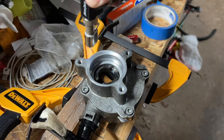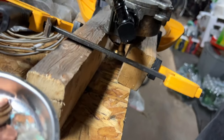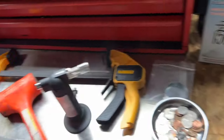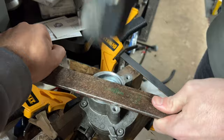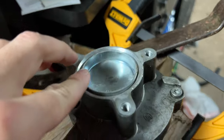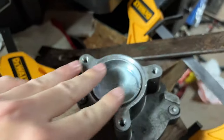We're just putting some heat in it right now so it expands to help it slide in a little bit better. Got the freeze plug. We got the little jig going right now. Two 2x4s, two clamps. All right, boys, so that clamp didn't work. So we got this pry bar here. I'm basically gonna show you what we did. Just smacked her in there. Yep. She's flush. It's good to go. She didn't leak. It's kind of annoying to get in, but she's in. She might need to get in a little bit more over here, but should be good.